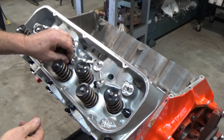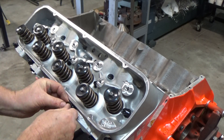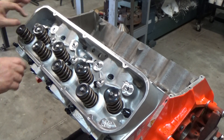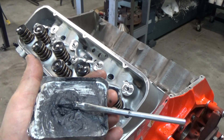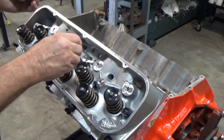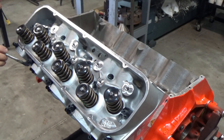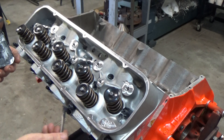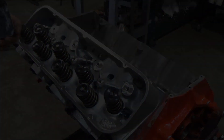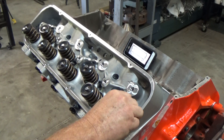Get the washers on there. It's also important to make sure your washers aren't too big for the socket machined out in the heads, so I'm just making sure they all seat well. Now that's the ARP lube — it gets all over everything, but I just want to make sure I coat everything well. Go ahead and get all the nuts on there.